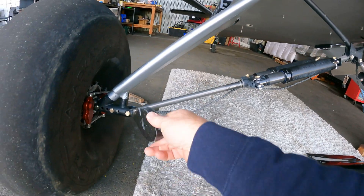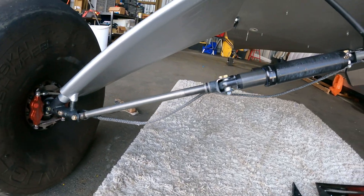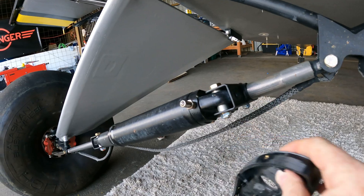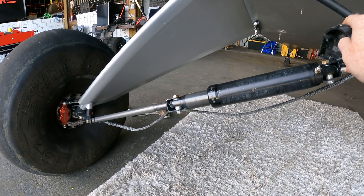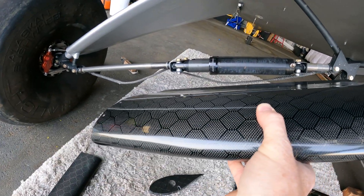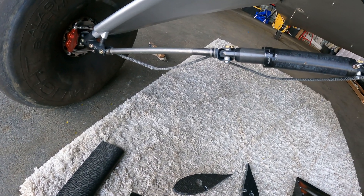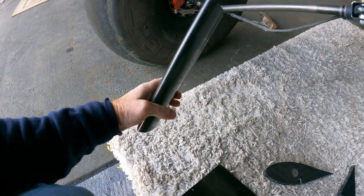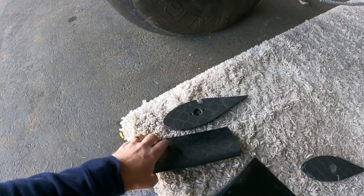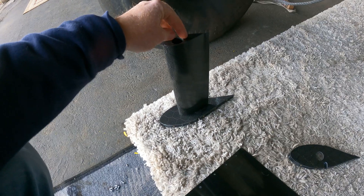In order to install these, we have to remove the shock because they need to slide in over the bottom shaft and the top shaft. The top one attaches to the top of the T — we're going to drill a hole and rivet it to that top part of the shock. Then we'll slide the shock cover up over the top and fasten it to the rib. The bottom one slides over as well, and you can see the two holes that go into the larger holes on the bottom rib.